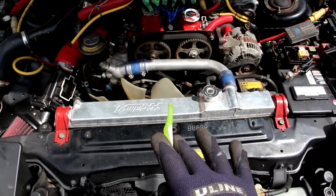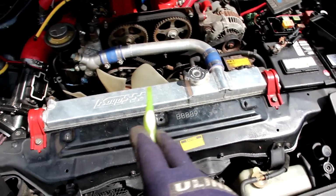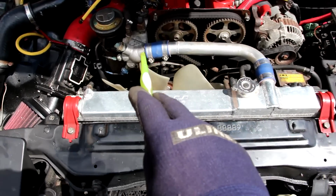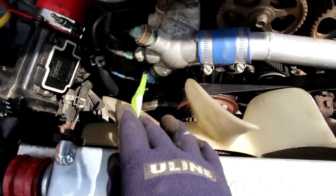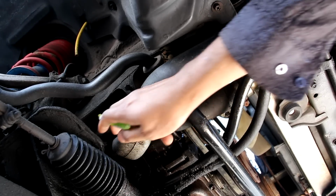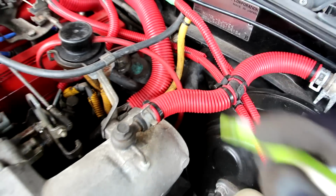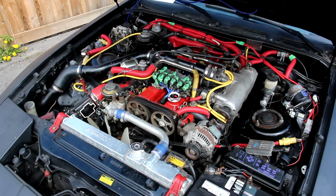Now coolant's going to begin its journey at the overflow tank, which is in front of the radiator here. It'll then travel to the radiator itself. You can see this looks like an aftermarket unit, and it's pretty easy to service. We have this top radiator hose over here that leads into this coolant temperature assembly, which houses the thermostat as well as the coolant temperature sensor for the gauges inside the vehicle. Now once the coolant has circulated through the block, we have this coolant hose here where it's going to then return over to the radiator. The cooling system is also going to have another loop that goes into the dash for the heater core. And now let's have a listen to the startup of this legendary engine.